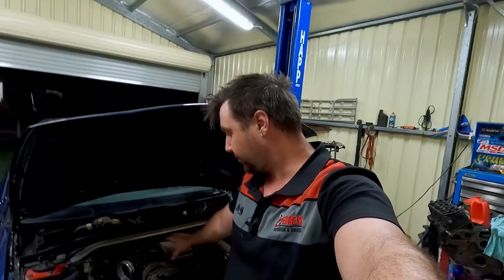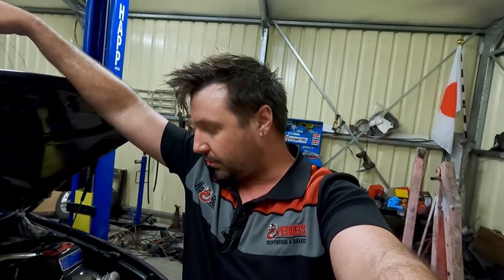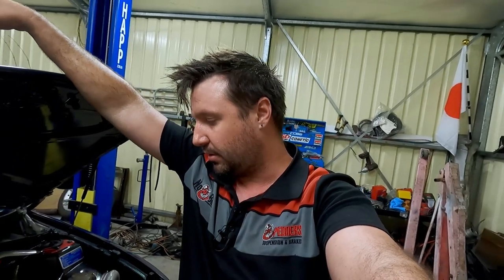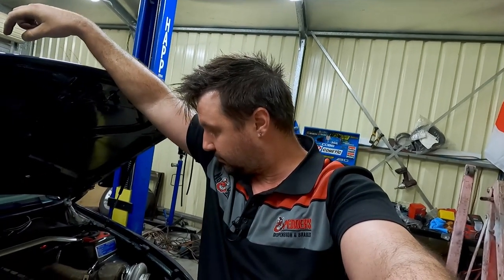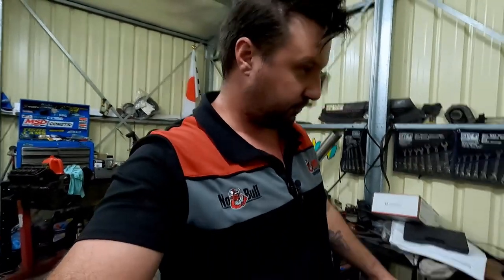I don't know, there's still a couple of options I have. I can either go over to an electronic throttle body, but I already got my Wiggins clamp welded on there, so I'll have to cut that off and weld it onto the electronic throttle body, or I can go and reconnect the idle air control valve and then just buy the input output expander box. So I'm not sure which way I'm going to go about it.